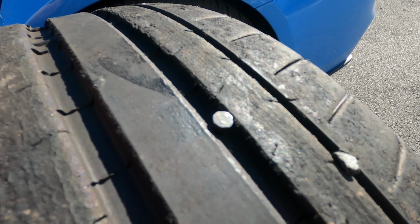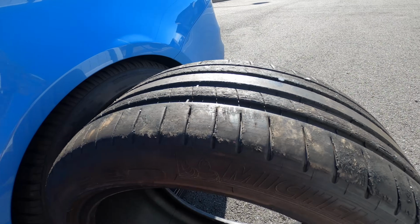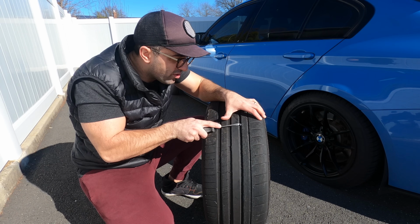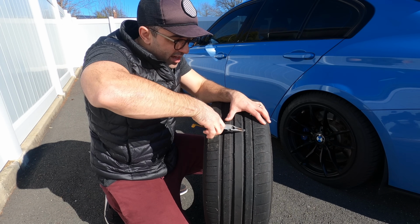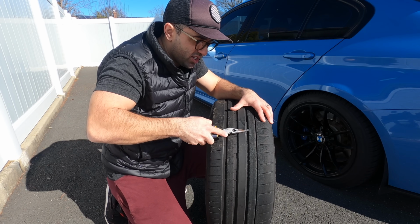All right, as you can tell, the nail is through the tire, and now I'm going to show you how to take it out and fix it on the go. So with the nail embedded in the tire, you can take it out in two different ways. A lot of times you can just pry it with a screwdriver, especially if it's stuck deep in there. But a lot of times needle nose pliers really help. And once again, everything I'm using I'm going to link in the description, and check this out.